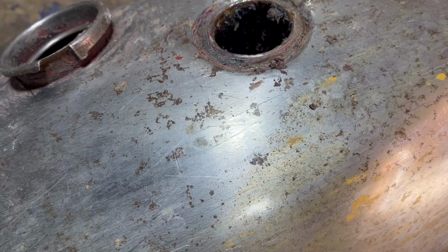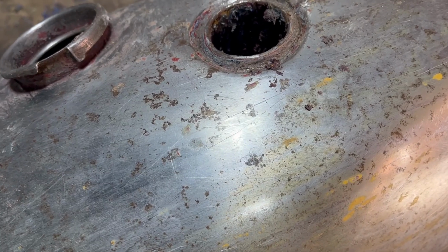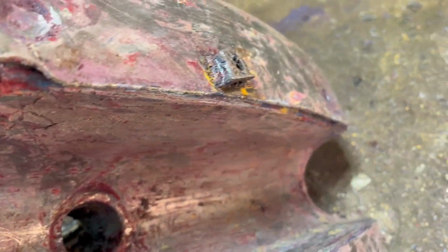But in general, the tank's very solid, but now you can see better all these untreated rust areas, and that's underneath, you know, 4 layers of paint. So it basically was lacquer, blue, grey, which is probably undercoat, red, yellow, and then onto this. And it was never yellow originally, so all the original paint was taken off at some point, and they didn't really prep it. So we will rub this down well, and we'll prep it with rust kill. We'll have to. Still got a bit of work to do on the underside yet, but nearly there.